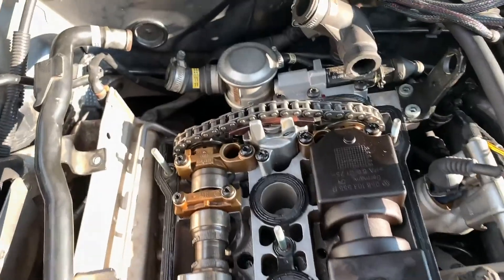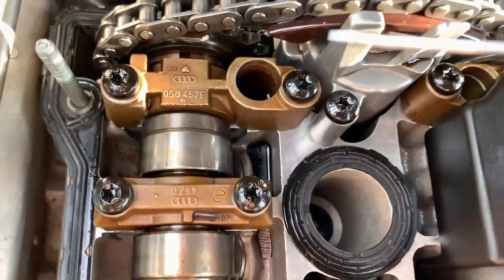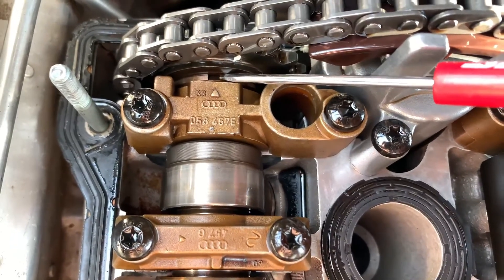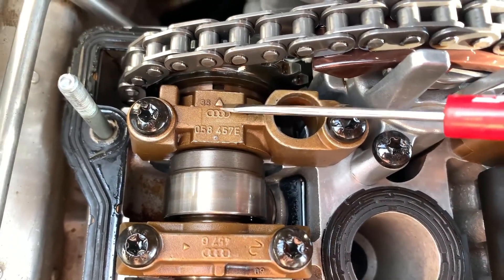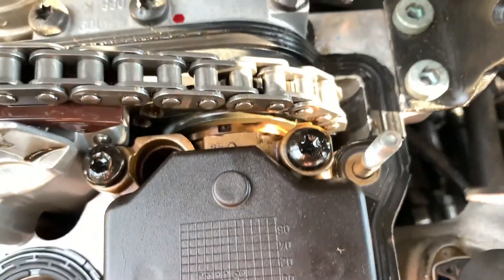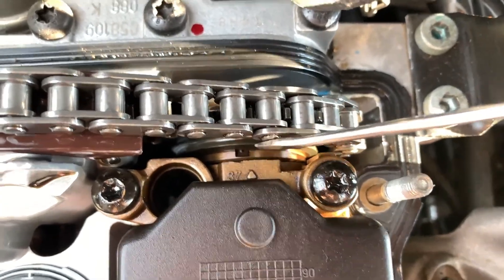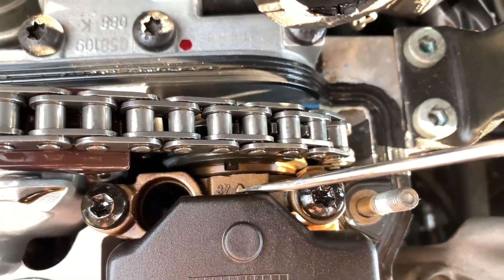You've got to make sure your timing is just right. You'll see here there are some timing marks on the actual shaft — the camshaft. That needs to line up with this cap, with that little arrow there. So that looks good. This does not look good — this one's off right there, you can see. So there's the camshaft and there's the mark.